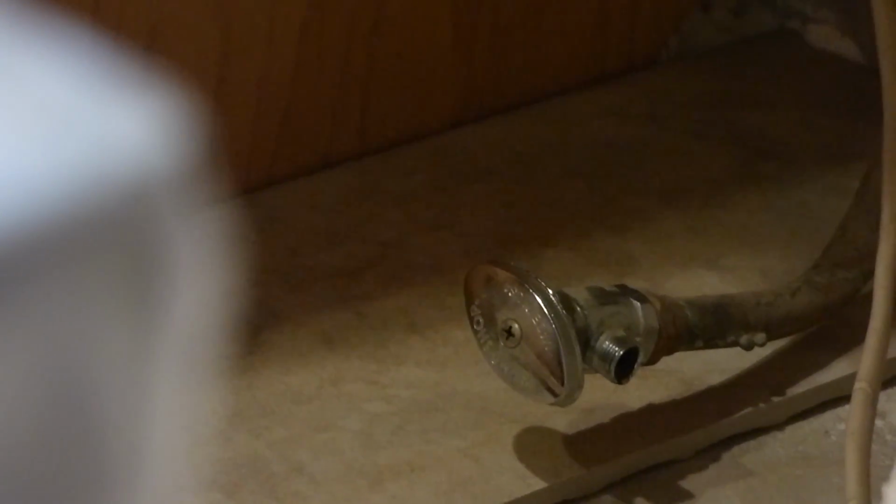And it looks like one of those kind of valves. And I turned the water off the house to remove the old one, and then I shut that valve and it stayed shut, and I turned the water back on, and it's drip free. But I have a feeling if I install this thing and it's all in place and I go to turn that valve back on, it'll probably leak. So instead of that kind of valve, I have a quarter turn valve that I'll replace it with.